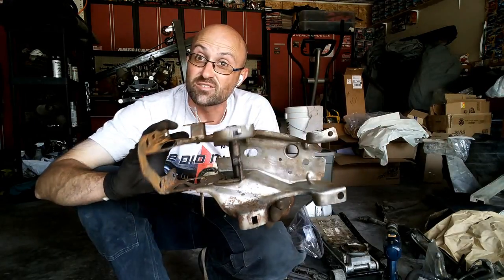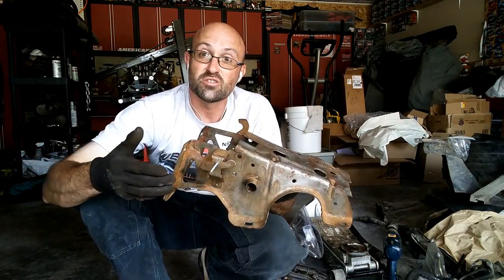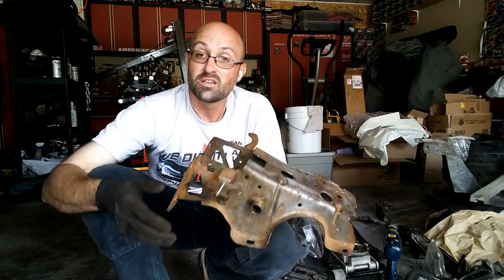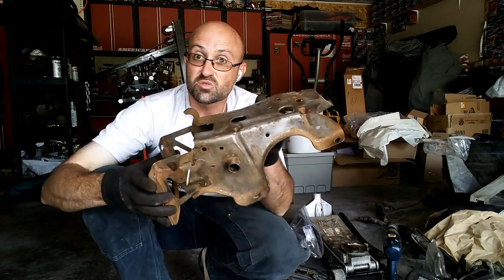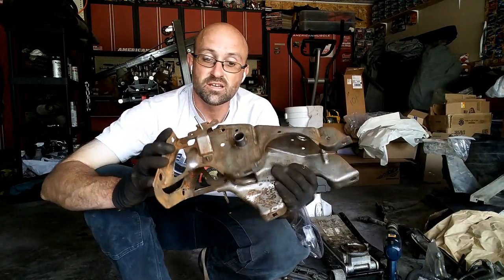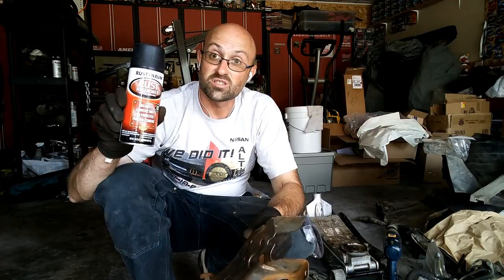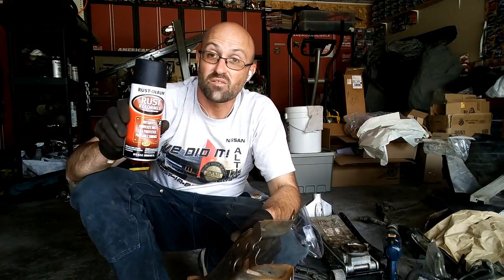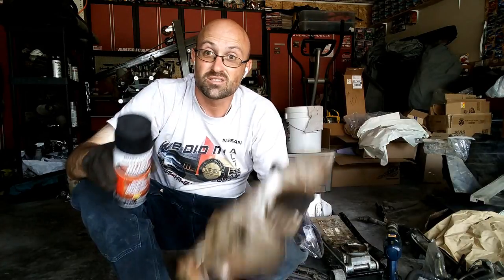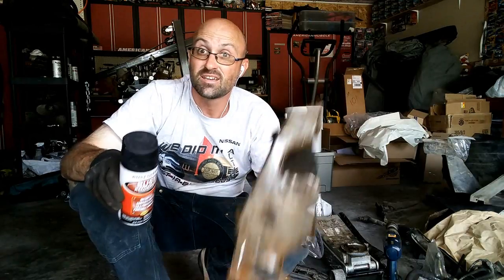Once you've got it down to a bare chassis, you can start sanding. Depending on how much rust you have, you can use either a wire brush or some sandpaper. I did this with 400 grit plus a little bit of a wire brush on the hard areas. The key is just to get it down as best you can before you hit it with some rust reformer. This is the same stuff I've used everywhere else on this car because it works. Get it down as best you can, clean it — remember prep is key for paint — and then have patience while you spray.